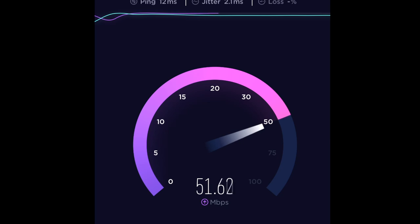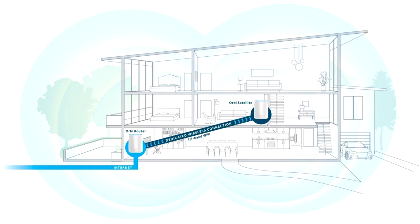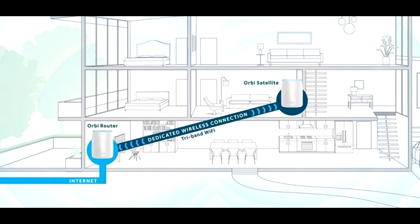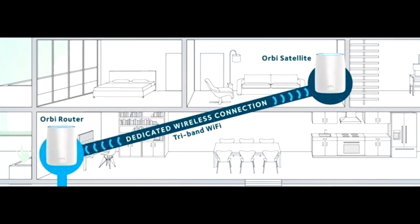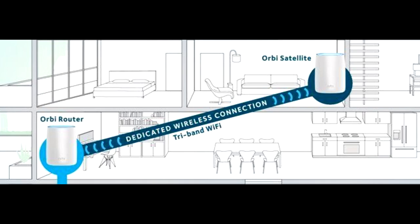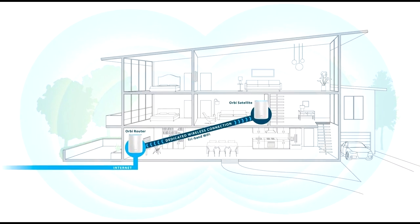Let's now take a look at what makes the Orbi Wi-Fi 6 system so good from my perspective. As touched upon earlier, the Orbi is a tri-band router, which means there is a third channel dedicated to the backhaul communication between the Orbi router and its satellites — in other words, it creates a virtual wire dedicated solely for data flow between the router and the satellites. In contrast, dual-band solutions use the same Wi-Fi bandwidth to connect to end devices as well as between the access points. By using a tri-band architecture, the front-haul channel is immediately available for devices to connect, improving efficiency especially as more devices are brought onto the network.